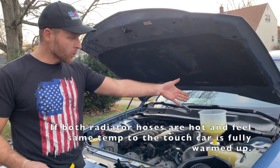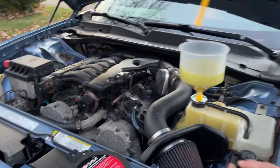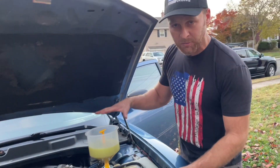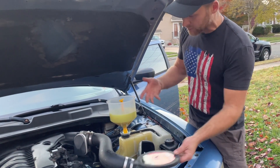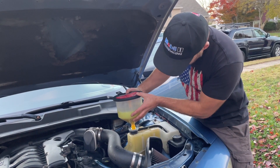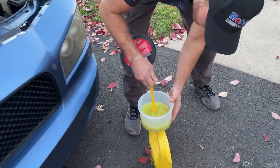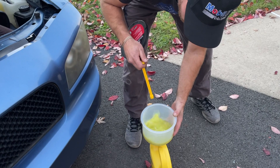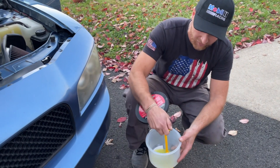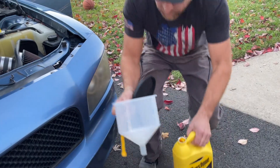Fluids are replaced. Now we can remove the funnel. You can do this while the car is running — if you have this funnel kit it comes with a little plug which you just shove in there. Be careful when removing because it's hot after running for 20 minutes — you don't want to spill this on the car or yourself. I'm going to pop this off and drain the excess into my bottle. If you were doing an old-school regular funnel, you can take a long screwdriver, wrap a rag around it, shove it in the funnel and pull it out the same way. But for 20 bucks, this kit is very convenient.